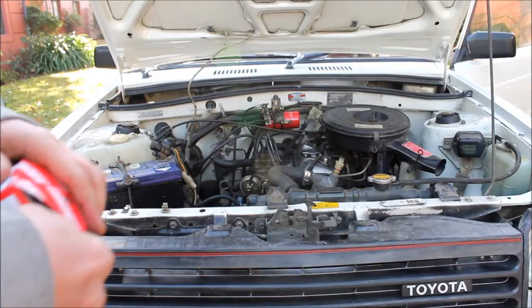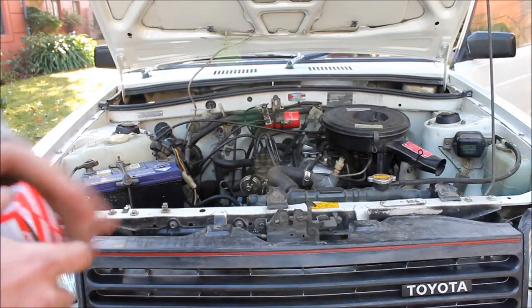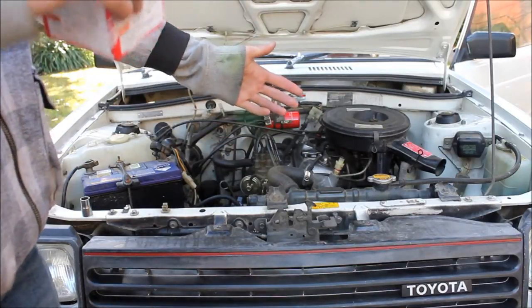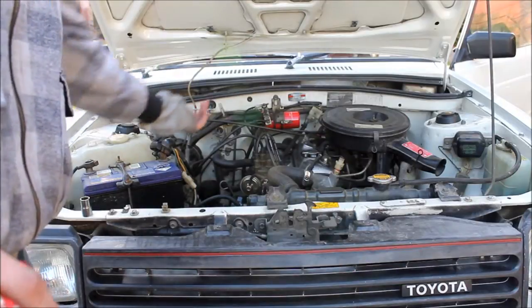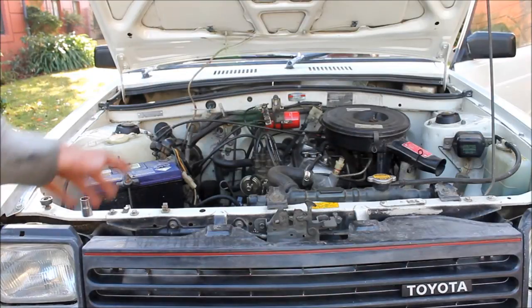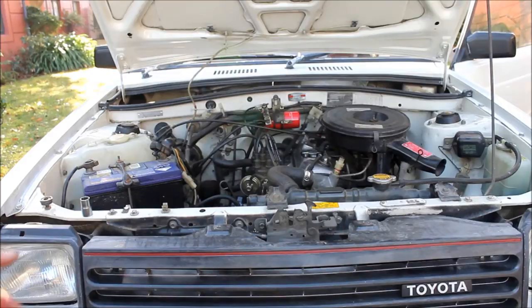The transmission will be a bit more difficult to get oil into because I've only got one funnel — you usually run a funnel with an extended neck down to the side of the gearbox. I'm not going to change the differential oil today because I did that back in November and it's all still good. The brakes were serviced about a month ago with all new fluids and new pads. Coolant's still good, changed that back in November, and that's good for another few years.